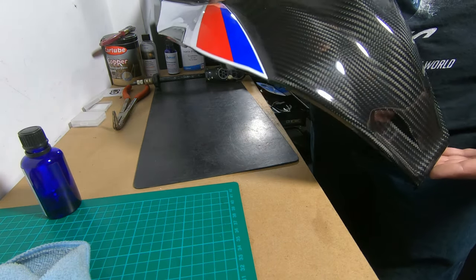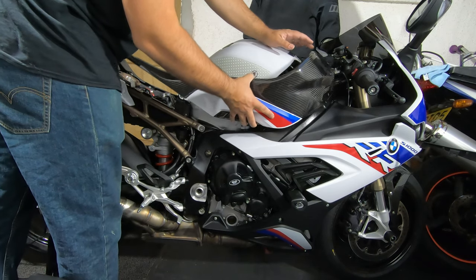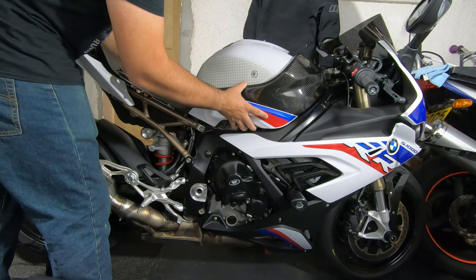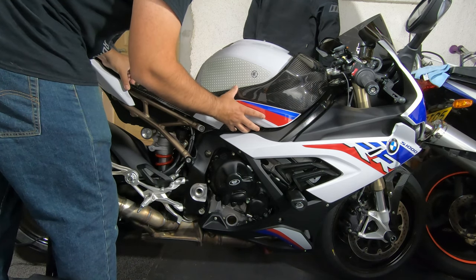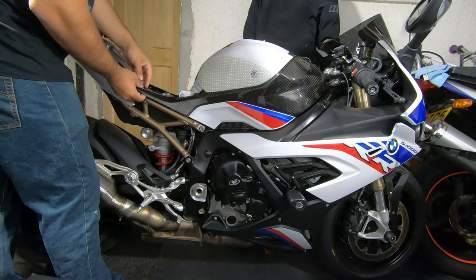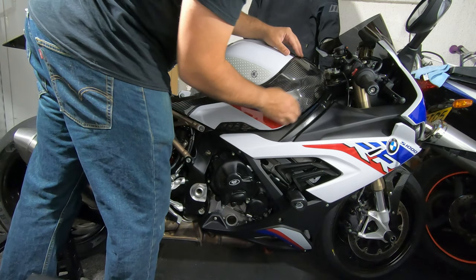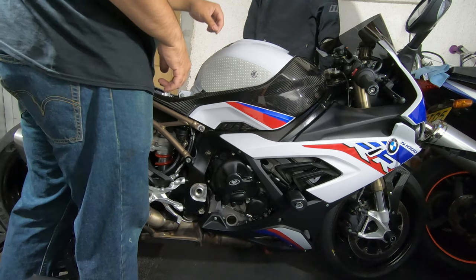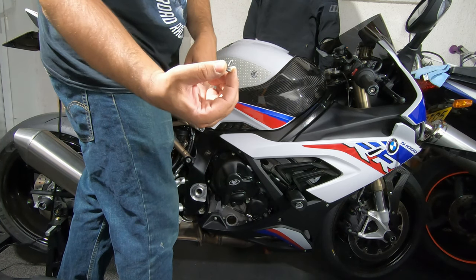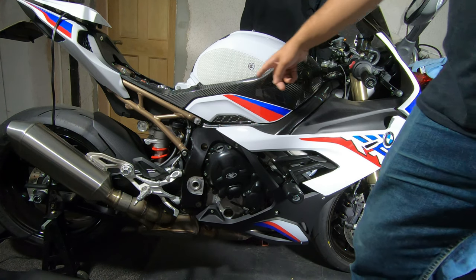Still keep a bit of the colour but you've got carbon fibre all around it so it looks really smart. So now we're going to offer up the carbon fibre part to the side of the tank. We're going to get it almost in place. There's a tag here and we've got to put a little tag behind here so we need to slide it from front to back — we line that up, make sure they're both in line. It needs to be just forward of where it needs to be, then we'll just slide it back. It's held on now. Then the tail section — there's a little clip at the back, just push it in, it should click. That screw hole is absolutely fine, this lines up nicely. I'm going to put this screw back in. The screws as per usual are completely dry, so we're going to put a bit of copper grease around it just in case any crack gets in there — I want to be able to get the screw in and out nice and easily. So that's that side installed. Looks ten times better already — really nice. We've got the little carbon fibre fins down here. Looks awesome.